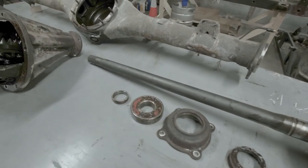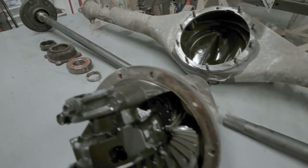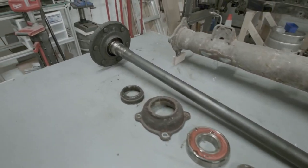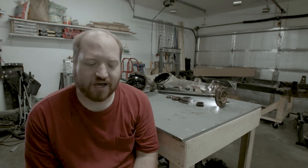With the axles pushed out of the bearings, I think this is a good point to end the video. If you're watching this for any instructional purposes, a tip on pushing the axles out with the press: before you put them in the fixture, it's a good idea to spray that bushing with penetrating oil and let it sit overnight. After that, hitting it with a dead blow and a cold chisel or some kind of blunt object on a couple of sides helps break that bushing loose so it'll press out.